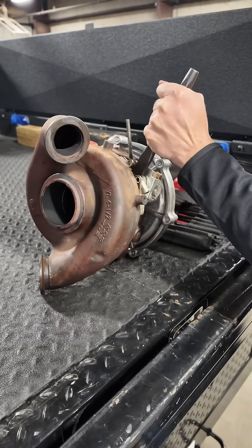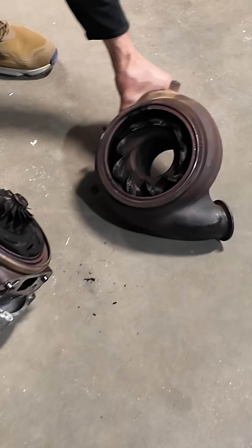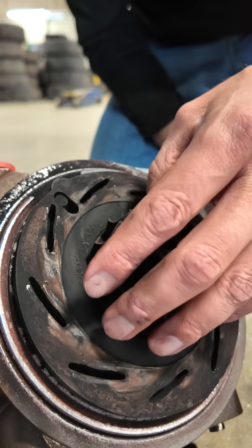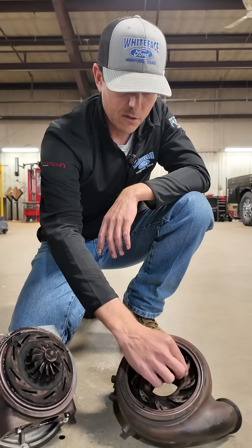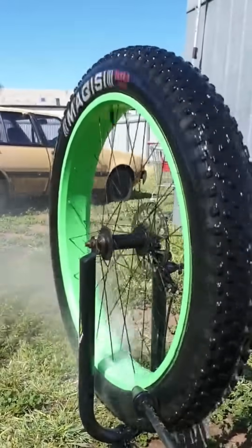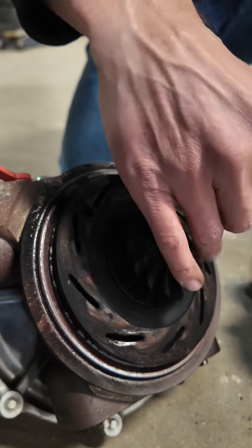I tried several times with the chisel to get it open. It took a pretty good beating with the mallet to get this thing off, so you do run the risk of cracking that housing. But now when someone mentions something about the turbo vanes, or you want to know how your exhaust brake works, you'll know exactly what these things look like — it's like a little flower petal. Just picture that bicycle tire as a kid with a water hose: move the water hose further in and faster that thing will go. So it's changing the direction of the air as it hits this wheel.